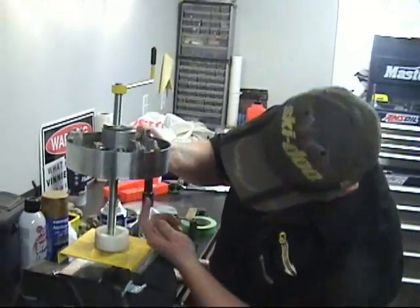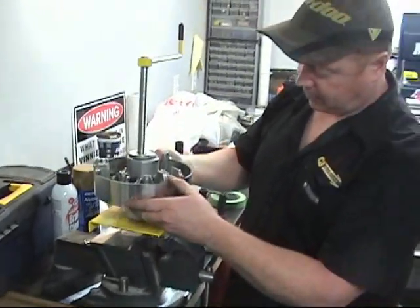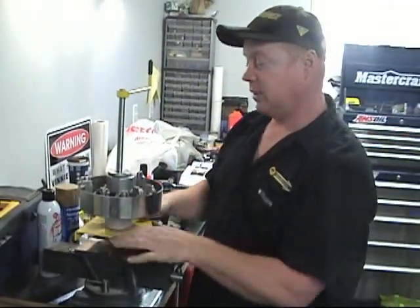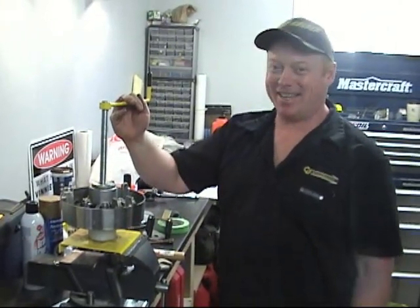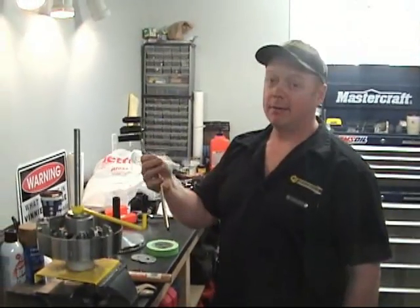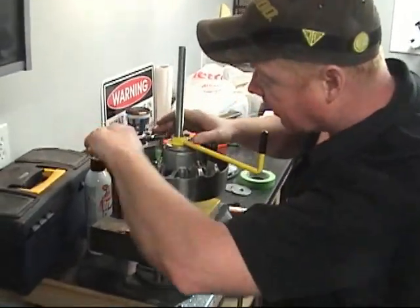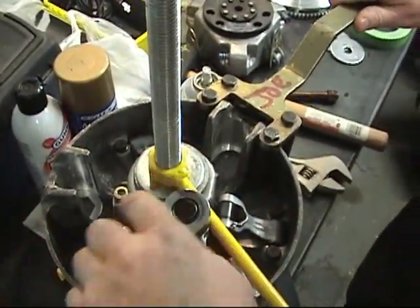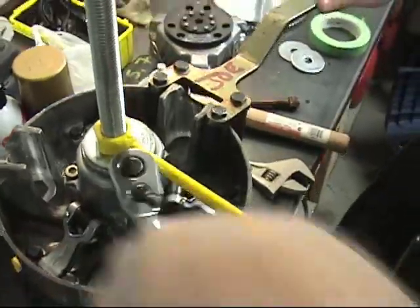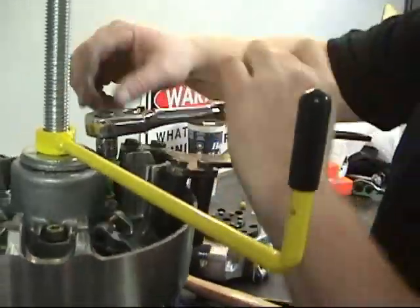This is the CT Power Sports Rev XP clutch maintenance toolkit. For this particular clutch I like to use the spacer from the secondary clutch tool, because plastic won't hurt the surface. We're using Chris's tools because I didn't forget them this time. I like to use the trusty grunt tool to help take the spring cover fasteners off — it makes it easier to hold the clutch, especially when you go to torque the fasteners back down.